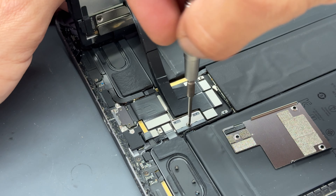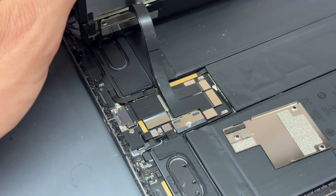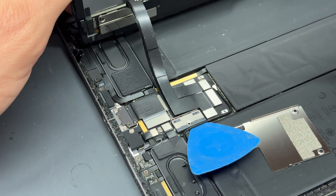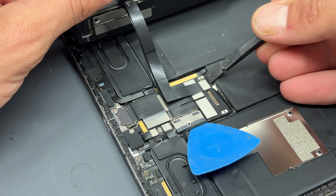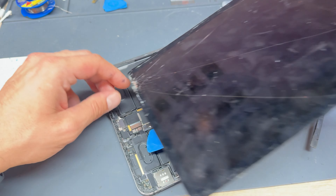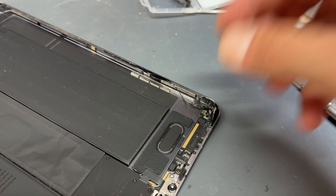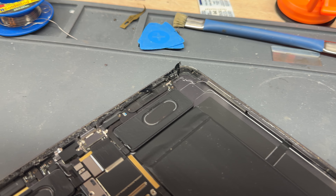Remove the crosshead screw holding down the battery connector, then use a plastic guitar pick between the battery and the motherboard to isolate power from the device. You can check by pressing the power button. Then use a plastic pick to remove the flex cables for the display and the two for the digitizer. With those removed, we can separate it and put it safely aside. Before fitting the new screen, it's important to make sure the chassis is nice and clean — there's glass, glue, and all sorts that need to be cleaned up.